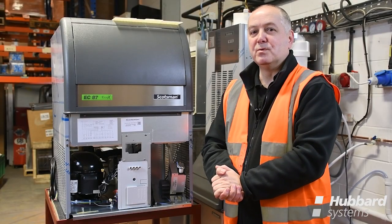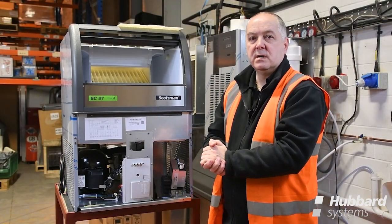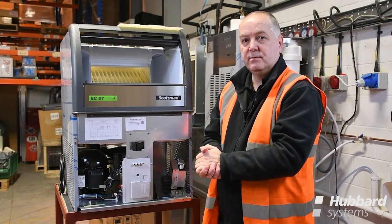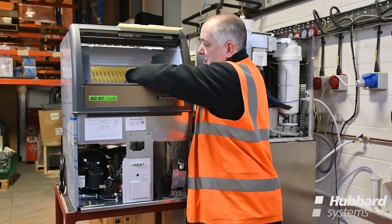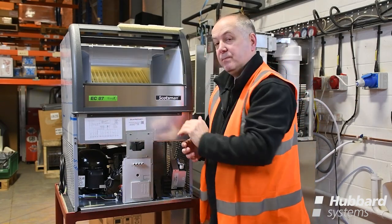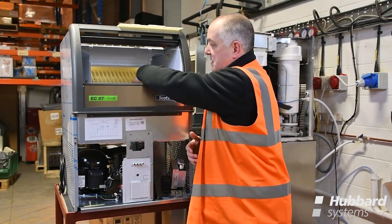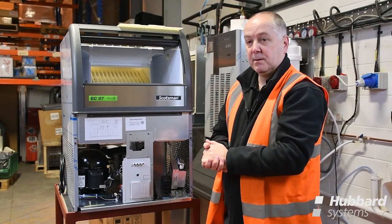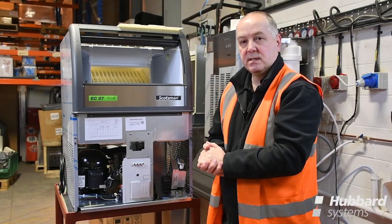This section relates to the more common mechanical failures found on Scotsman ice making equipment. On attending a service call to an ice machine reported as not making ice, one area to check — assuming you have an adequate water supply — is the water level inside the sump chamber. If the water level is low, you may find a loss of water via a drain valve leaking by or a sump cap knocked off by someone retrieving ice aggressively from the storage bin. If the water level inside the sump chamber is higher than expected, your problem may relate to a failing pump which would normally pump water through the spray jets and into the evaporator section, and would need checking and replacing as required.